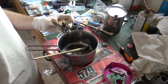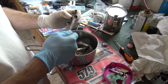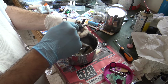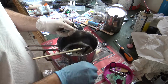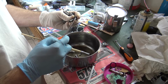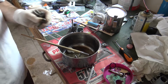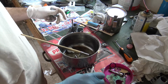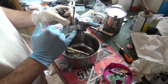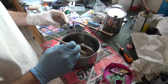Replace the gaskets also here with new ones. Of course, a little clean also here. This is the fuel hose connection, and you have two gaskets here. One between the screw and the hose connection, and the other between the hose connection and the carburetor. The reason why I suggest substituting the gaskets one by one is because you may easily recognize which one goes there, and plus, there is some place where there is no gasket. For instance here, there was no gasket, and I have no doubt, but I could spend a lot of time recognizing it if all the gaskets were removed.